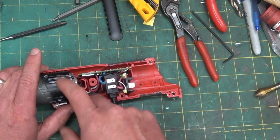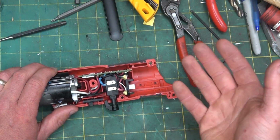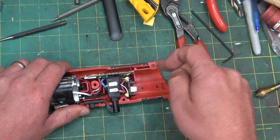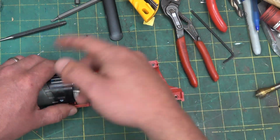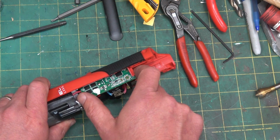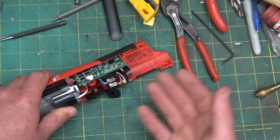One of the things: this is a brushless motor, so it's essentially a three-phase AC motor, and in order to take the 12 volts out of the battery and turn it into three-phase for this motor to run, pulsing DC into each of the three phases, well, yada yada yada. You've got to have some brain boxery, so you know intrinsically what is going to fail.